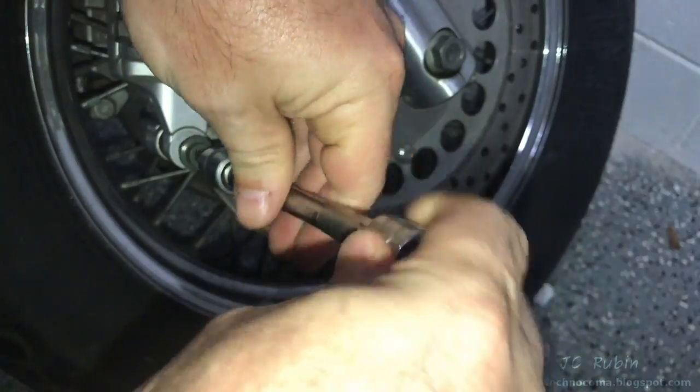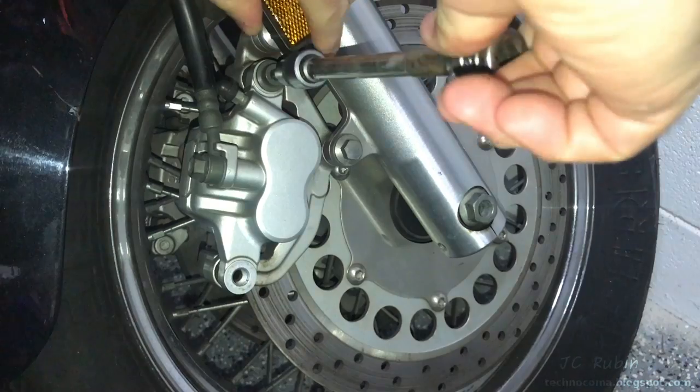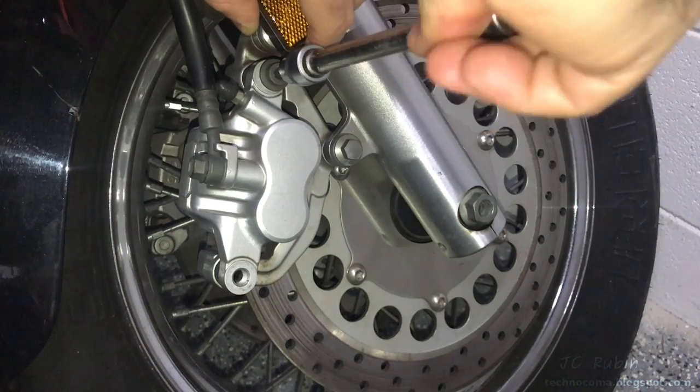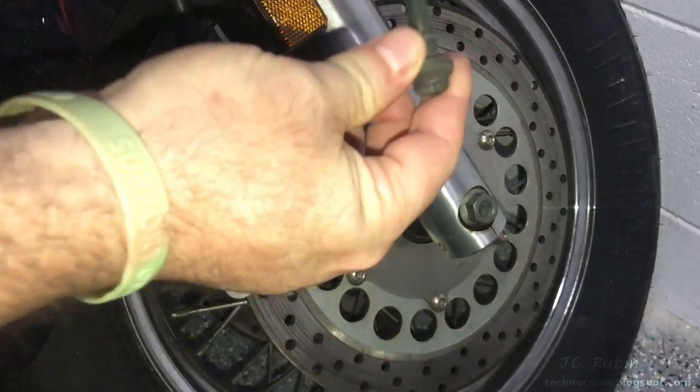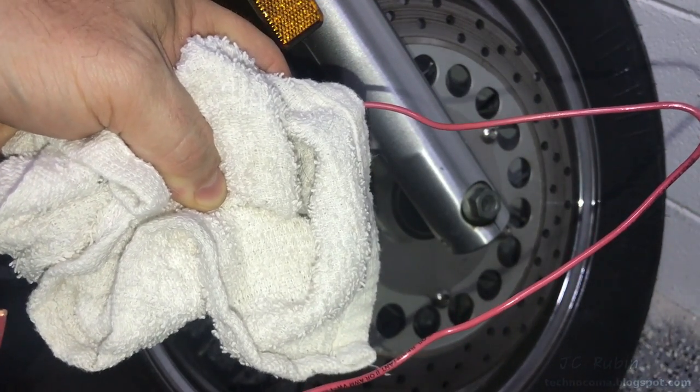All I'm doing first is breaking torque on each bolt, nothing more. Then each of them can just be unscrewed with an extension. If the recess was properly greased, we can see there's no rust or any accumulation — just some old grease at the end of the bolts. I'm going to make sure I have that cable and clean towel within arm's reach.